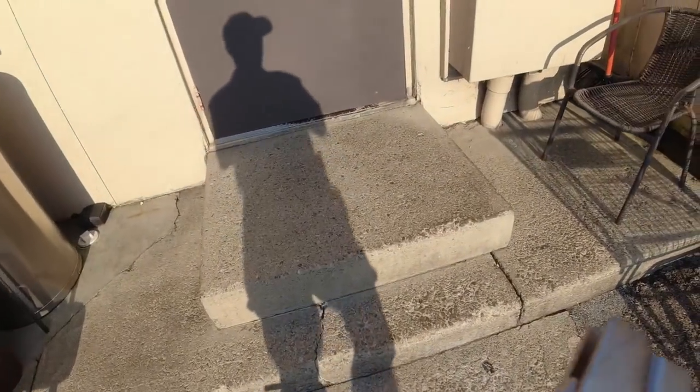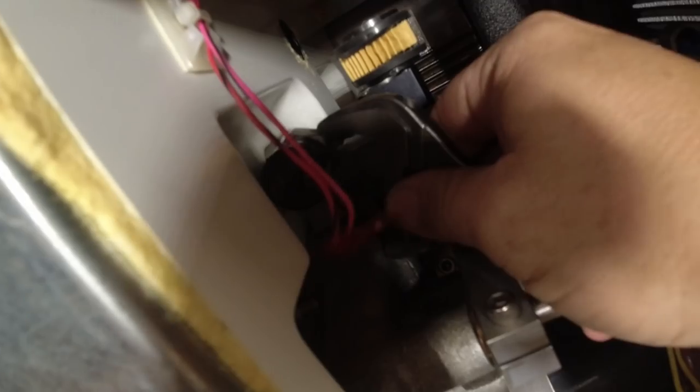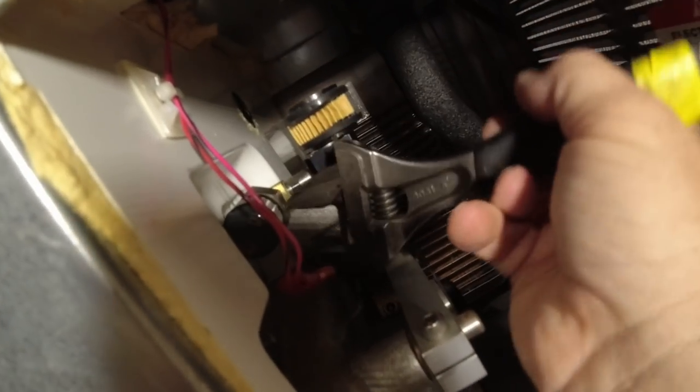We've got a few parts to put on and a couple coolers that aren't working. First one's an ice cream machine — I found a temporary one on my truck and I'm getting it replaced. A lot of people don't understand that on soft-serve ice cream it's 40% air. It's called an overrun — it's what makes your cone fluffy. This switch here turns the air pump off.